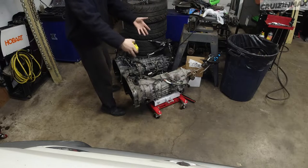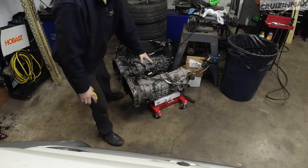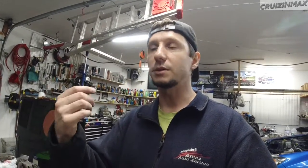That's really the main reason why these five-speeds fail. You put 300 horsepower on your WRX and for a week it'll be fine, but under the extra torque your engine is producing, the transmission casing actually twists. With the casing twisting, the internal gears and bearings are no longer true to each other — especially during gear changes, launches, and acceleration in first and second gear. There's no way this transmission would survive 400 wheel horsepower — it would probably break during the tune.